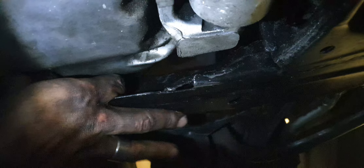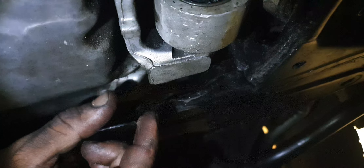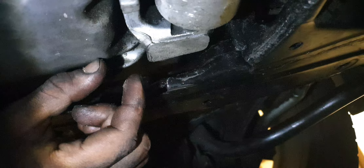Part of the subframe is still covering the oil pan, but it's only about two or three centimeters — which is absolutely nothing. You have that drop-down space, so once you drop it down and slide it out from this side, it comes free.